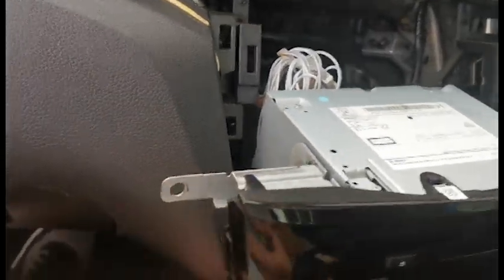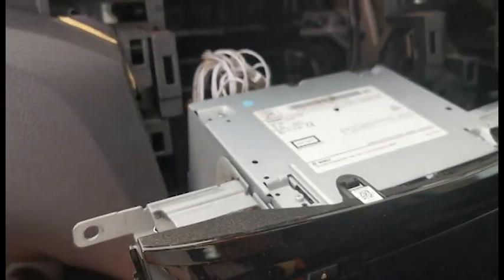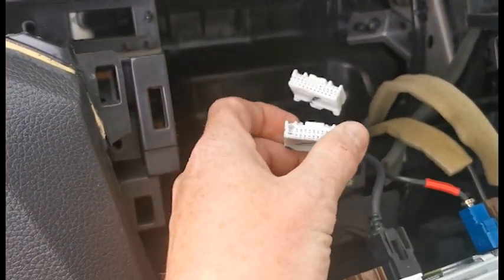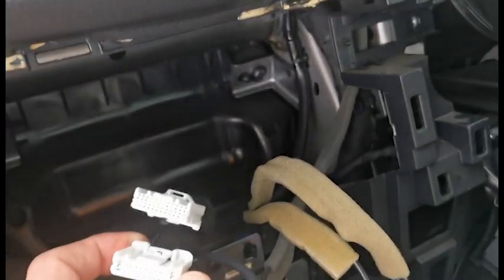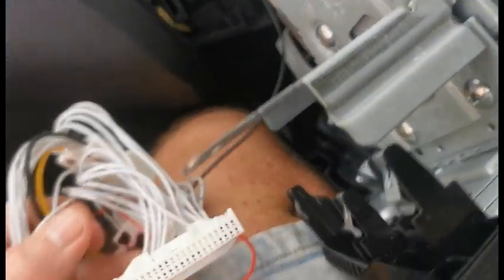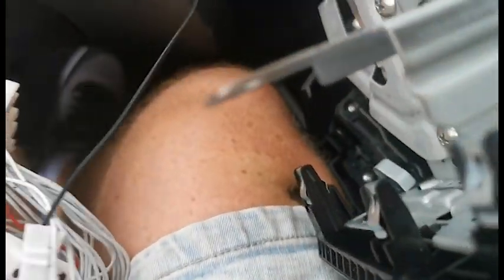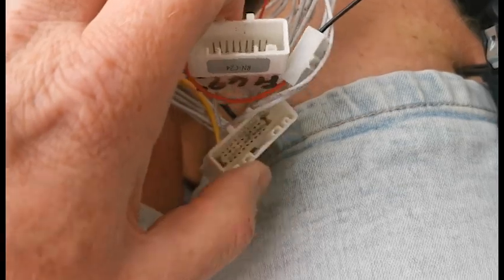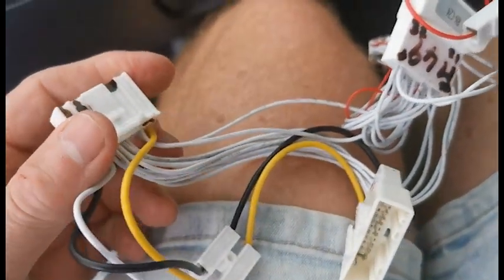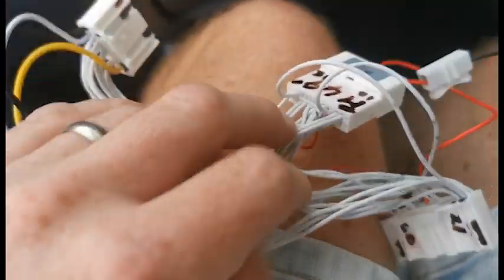Now I've got my wiring loom in here, but I'm going to take it out because I'm going to add in my new circuit board to see if I can bypass the security. So this is what you have in the original Qashqai — these kind of connectors, both about the same size. This is what you've got in the back of the new radio — quite different. So this is the harness that we make up. These are the connectors that go to the new radio, and these are the male connectors that go to the old connections. As you can see, there's a crossover between the pairs — it's not as if one goes to the other.